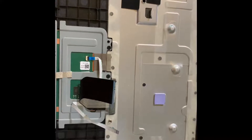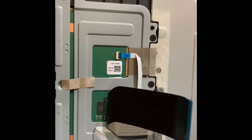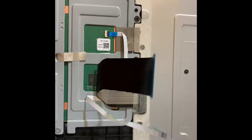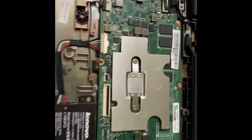After removing all 10 screws, you get to loosen up this panel which is the keyboard panel. Let me show you around the back — here are two ribbon cables: one for the trackpad and the other for the keyboard. The bigger one is for the keyboard and the smaller one is for the trackpad. Let's put it aside and look at the internals.